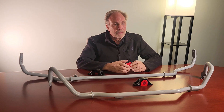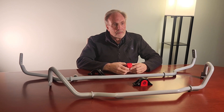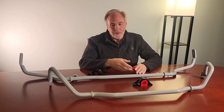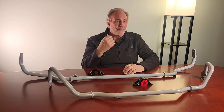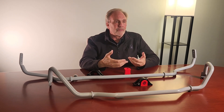We have the kit out for the all-wheel drive platform — I'm assuming next is the rear-wheel drive cars. How does that change the characteristics of the rear-wheel drive car versus all-wheel drive? The all-wheel drive cars tend to understeer because when you apply power, torque is transferred to the front wheels and differential, creating understeer. So on the all-wheel drive car, you wind up running the rear bars different — and the front bar softer. On a rear-wheel drive car with a lot of power, it wants to light up the tires and get sideways off the corner, so you'd run the front bar a little stiffer and the rear bar a little softer.